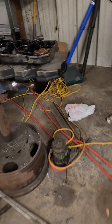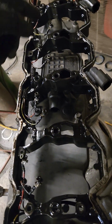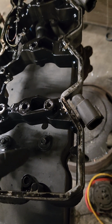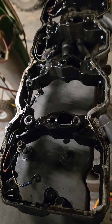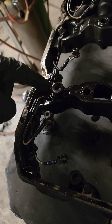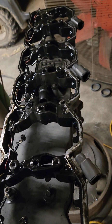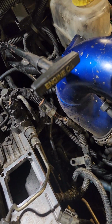So the rocker box, I told you there were more bolts. For some reason, I was blind and wasn't thinking. They are at the tops here. There's, what, 5 of them? 5 of these across the top and then 1 at each end. I'm not 100% sure if you can buy replacement wiring harnesses or if you have to buy it already in the rocker box. But most likely, if you suspect you have a bad wiring harness, because these wires will get chafed sometimes in these little spots and it'll expose the bare wire, the easiest thing to do is just buy a rocker box. Fortunately, knock on wood, I haven't had to buy a rocker box yet because of wiring issues. So I'm going to pull that intake horn off. Alright, now my intake horn is out of the way.